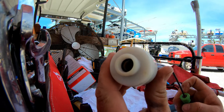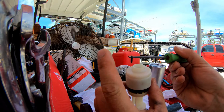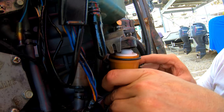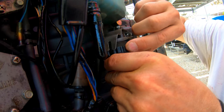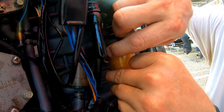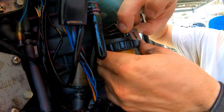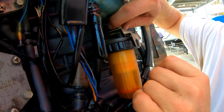Do not forget: inside of the old filter there is an O-ring. You want to make sure you pull that out and get it put back into the new one before you put it on. Look up in here and push this up until it slides up in there, then just tighten it up. This doesn't need to be torqued down to 100 foot-pounds — this needs to be hand tight. About there. Tighten up your bolt and now you're done.